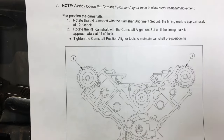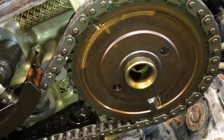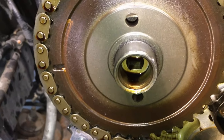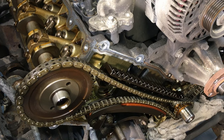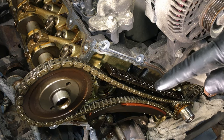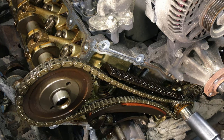Here's how you want it to look: the crankshaft timing marks should be positioned properly — not the marks for the reluctor or cam position sensor, but the actual timing marks. We're going to turn the crankshaft clockwise to get everything in position, then lock down the cams and start tearing stuff down. For the critical pre-positioning step: get the crankshaft keyway — that little Woodruff key — facing straight up at the 12 o'clock position. Right now it's at about the 10 or 11 o'clock position, so we'll turn it clockwise to 12.